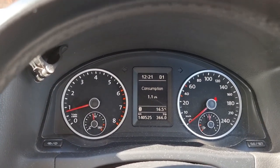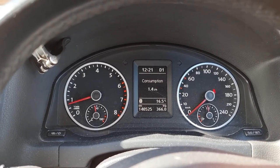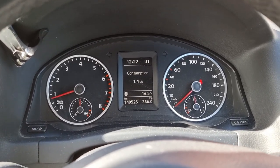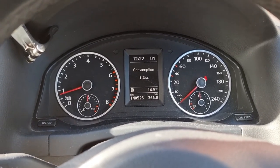So the trick is you need to cover up those sensors that detect the tow bar and rely on the other two. But that's certainly a lot better than just having the thing constantly beep, which renders your reversing sensors useless.